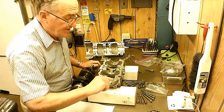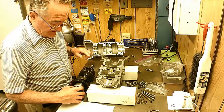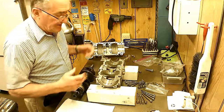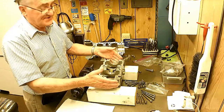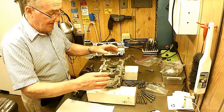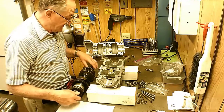The other thing I was going to mention is there's a little relief put in this edge. You'll see it several places here where there was an O-ring. The O-rings are there to prevent the bearing from spinning in there — just to kind of lock in the OD of the bearing. Because you can't make the OD of the bearing too tight on account of this piece is aluminum and this piece is steel. This is going to expand and contract a lot — probably ten thousandths pretty easily. So you need something with a little give, so that the crankcase can expand when it gets warm and contract, and yet still you don't want the bearings to spin. That's the idea of the O-rings in there.